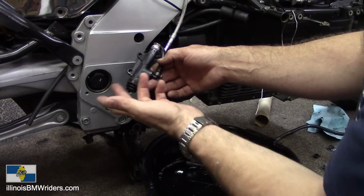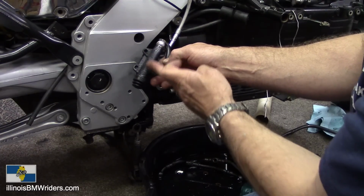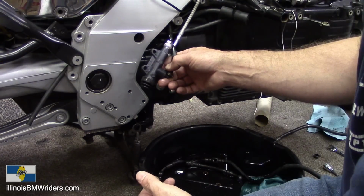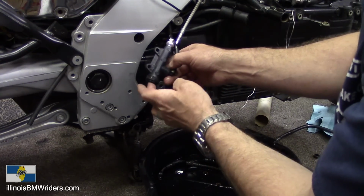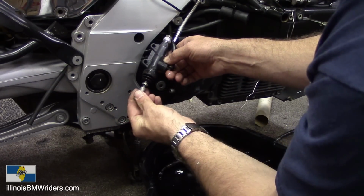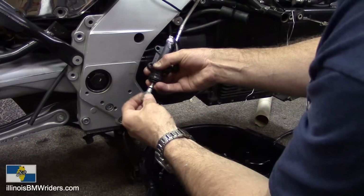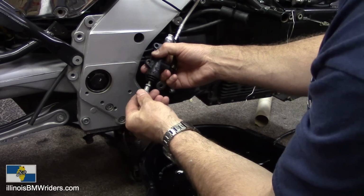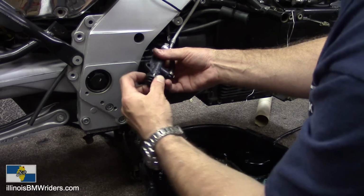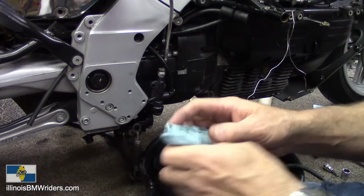So when you go to flush your brakes out, you're like, well, what's the deal? Everything's stuck. It's because the fill part is passed. So you want to get up past that and be able to utilize the whole thing. So like here it's just touching. Well, you're probably gonna have to adjust this thing down like this in order for it to actually remain down at the bottom. The little plunger that's in there. Just a little side note.